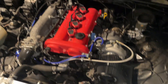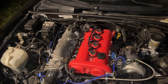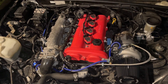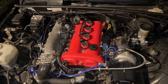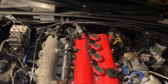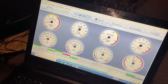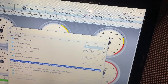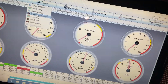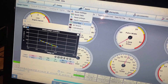I figured it out — currently with this ECU the sequential function doesn't really work, so I went back to wasted COP. That way there are only two outputs: one controls coils one and four, and the other controls coils two and three. It's working perfectly, so I'll leave it like this. In the ECU settings I set it to wasted COP, and I also had to adjust the dwell compensation, which adjusts the dwell time based on battery voltage.